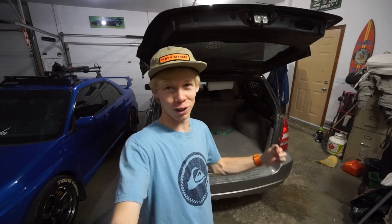Today we're actually doing something that's definitely not super critical, but it's something that I need to do because it's really, really annoying. As some of you Subaru owners have already dealt with, the EVAP system on some of these older cars are a little bit picky. Particularly the charcoal canister likes to go, the vent doesn't work anymore, or in my case, it won't fill up correctly. I also have a check engine light - it's for the P0457 code. It's an emissions code, of course, and that would make sense why my fuel tank is not filling up.